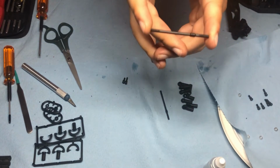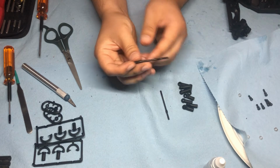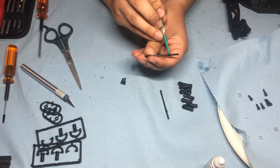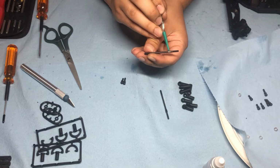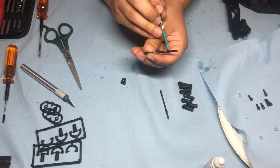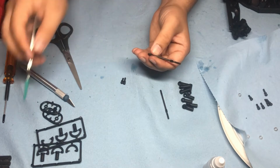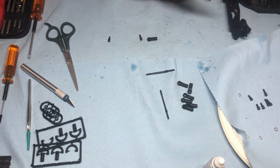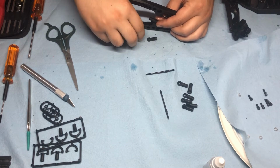So looking at the turnbuckle, the side with the adjustment point where it's square profile is going to be right hand threaded, and this side is going to be left hand threaded. Go ahead and use your shock wrench and install the ball studs.